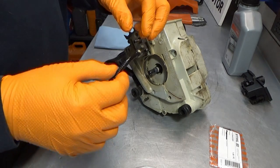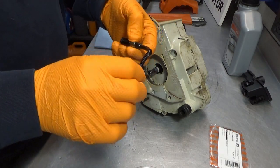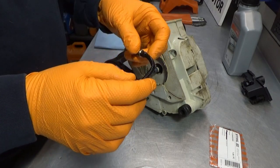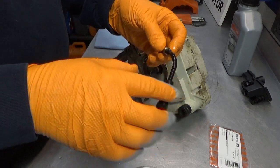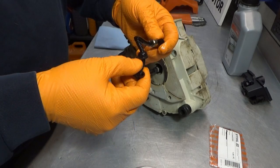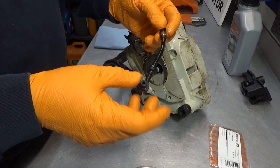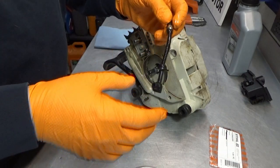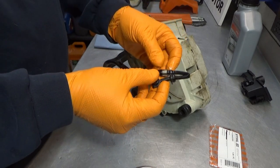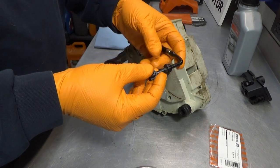Before we open up the new parts, I don't know if you remember when we took this apart, this oil line here has a kink in it. It's difficult to show on camera, but it has a definite kink here, and to be honest, that is most likely my fault when installing this a couple of years, maybe 3, maybe 4 years ago. So the oil line has been like this inside the oil tank, and thereby restricting oil flow.